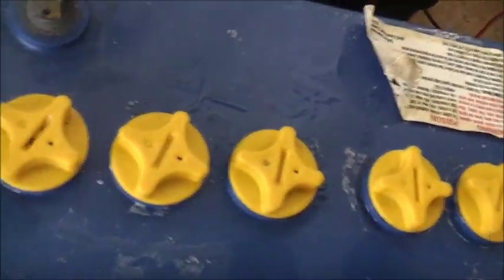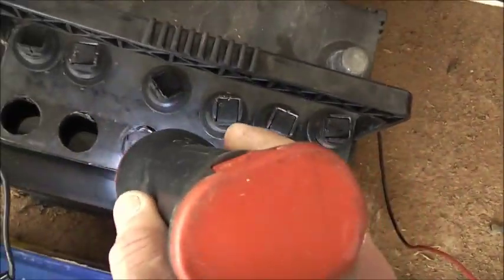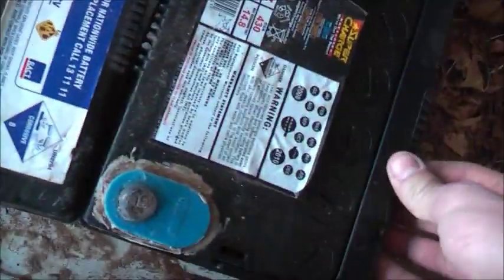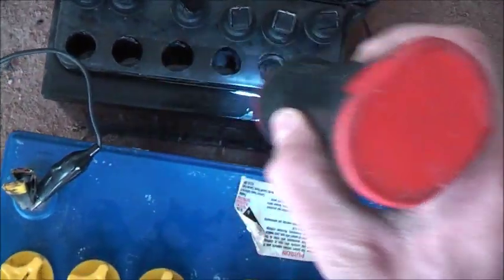During the alum conversion, condition is everything. I had a look inside the cells on this one — two cells here look like the negative plates are kind of pushed over. Even though this battery still tests 100%, that's a good comparison. That one there should revive if the plates look cosmetically the same as this one — so I might be able to revive it, since the plates in there look the same as this one, which is still 100% healthy after a good desulfate. Condition is definitely everything when doing the conversion. I'll let this one get a full charge first, then I'll do the same revival process to get this battery kick-started. Anyway, that'll be enough for now. Thanks for watching.